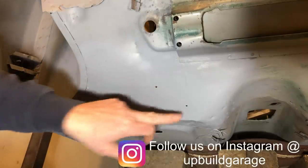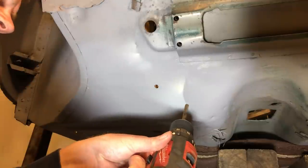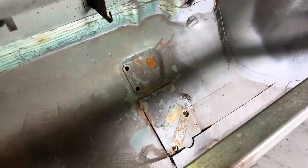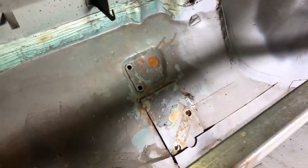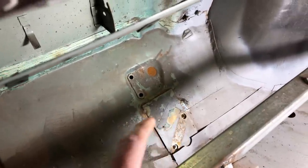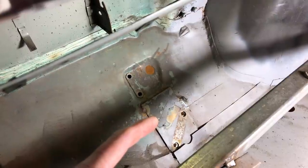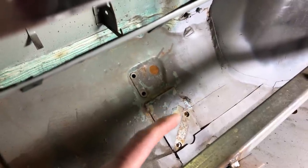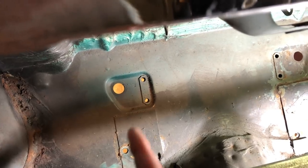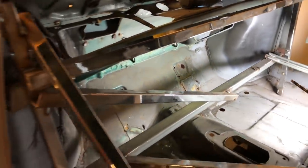We've got ourselves a couple of pilot holes drilled through from the inside. Basically, I used the spreader plate on the back as a template to drill the holes back through - put a couple of pilot holes through from this side and then drilled back through from the other side. So we've got our holes back in the right place. What I'll probably do is take that spreader plate off - it was pretty rusty - replace it with a fresh plate on this side, and probably the same on the other side, drilling the spot welds out and replacing them.